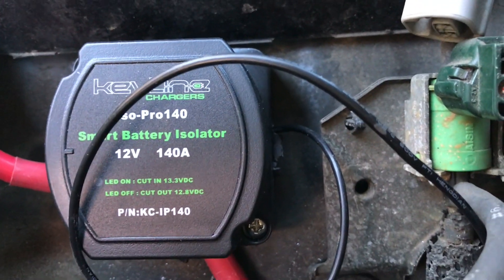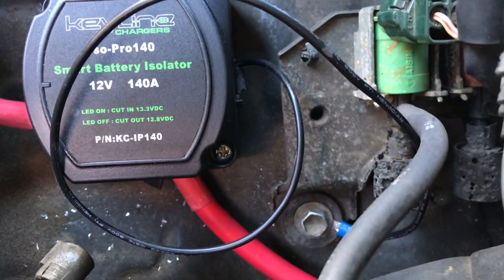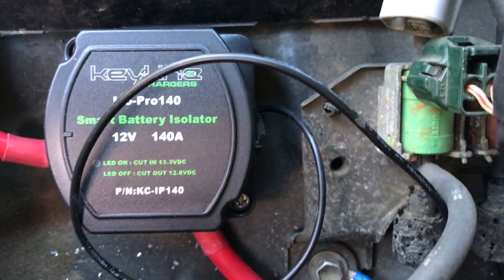I turned on the lights and interior lights and you can see the light went off — the voltage went below the charging limit of the starting battery. The light is on so I'll call it good. I don't have a volt meter at the moment but will test later. The indicator lights went on: it turned red when the starter battery was at the right voltage, so the auxiliary battery was getting charged. When I turned on the lights and shut off the engine the voltage went down and the light turned off. For now I'm calling it done — I'll do a follow-up video when I install the inverter. See you next time.